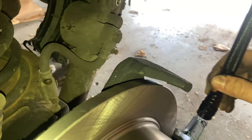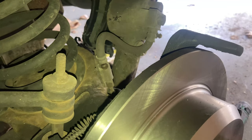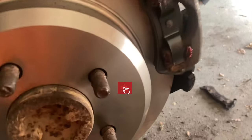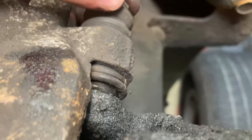Make sure you put the pads on correctly. Now set the caliper back on, but before we do that, add some grease to the areas where the brake pads rest and slide — both sides. Make sure these areas are clean before applying grease, then slap some on so there's room to slide. Rest it in the notches and make sure the back piece holding the screw is flush, then push it on. This little clip is going to clip it in — make sure the pin and caliper are properly seated.